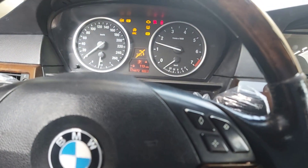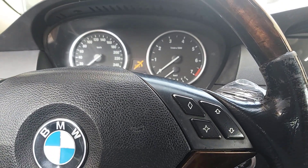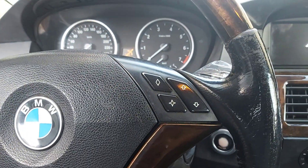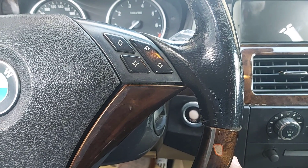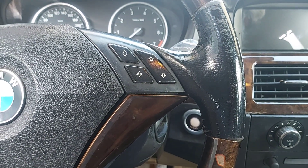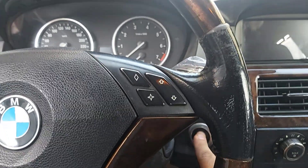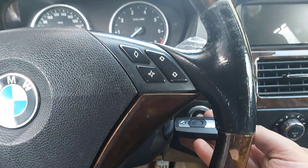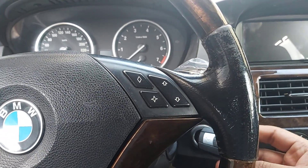The problem is: with the standard key inserted, ignition on and off works good. With the proximity key it also works, but if I switch ignition off and wait a little bit, then try to start with the push-to-start button, the car will not start. If I insert the key again and try to start, the car will start — notice: key inserted, remove key, start.